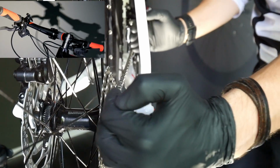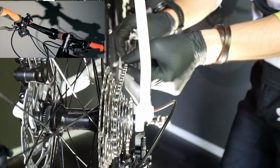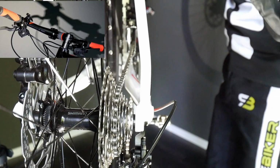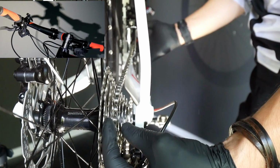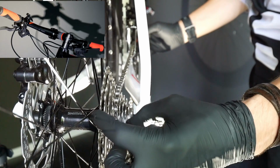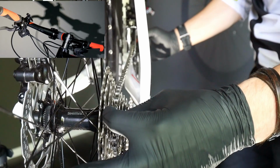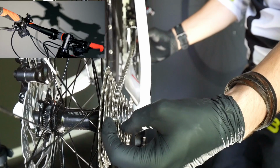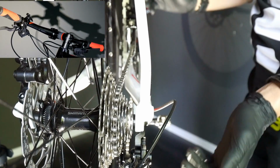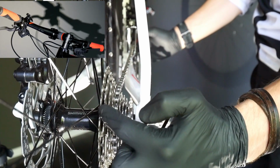You just want to avoid the extreme crisscrossing of the chain because there is a lot of friction here between the chain and the sprockets. It's wearing out much more quickly. So the middle chainring would be for the middle sprockets. That's easy. Let's say you have a 12-speed cassette. For the middle chainring, you would probably use maybe 8 sprockets in the middle of your cassette, and you're gonna use the same trick for shifting with both derailleurs simultaneously, but you're gonna do it twice here, right? Because you're gonna change the gears at the front twice going through the whole cassette.